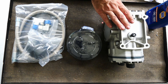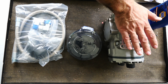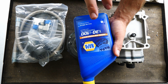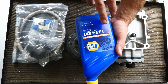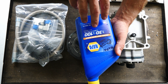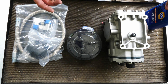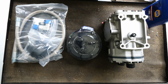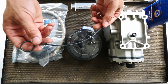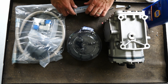To fill the York compressor — this is the standard York compressor, not the high-performance one they sell, basically the one you'd buy from any auto parts store — they recommend using non-detergent SAE 30. Their instructions give you a part number for a Valvoline brand. Little-known tip: Napa oil is actually made by Havoline and Valvoline, so if you buy Napa brand oil you're getting Valvoline at a much cheaper price. Also provided in the kit is a syringe and a handy dipstick — keep those in a bag in the vehicle at all times.